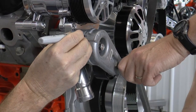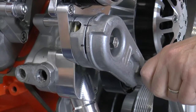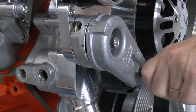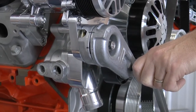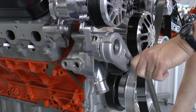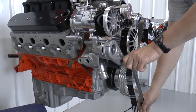What you're seeing there is you can tell how much that's moving. For the tensioner to move that much, that means that belt is stretching probably an inch to an inch and a half. There's a lot of load on these belts that people don't realize. For instance, I think this Magnuson supercharger — they say on an LS3 at around 14 pounds of boost — it takes about 80 horsepower just to turn the blower, which is pretty amazing. We don't think about there being that much load on a belt.